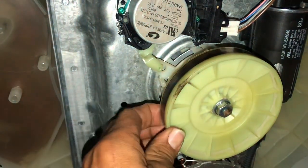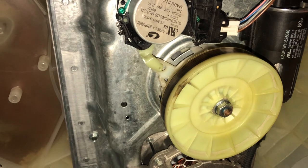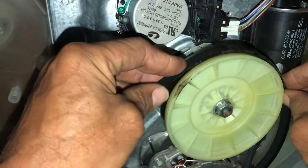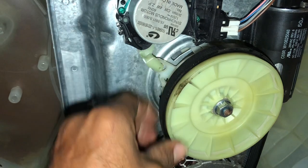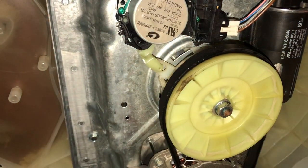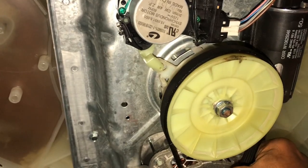Not good. Not recommended. You can end up snapping when you use impact. And you don't have a good feel of how much torque is being applied. Impacts have their places, but when it comes to certain things that can be damaged, they don't belong there. Once you snap a bolt, it's done. And to fix it costs way too much.